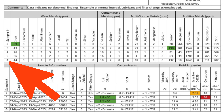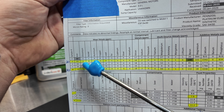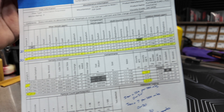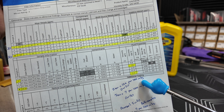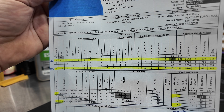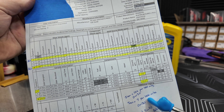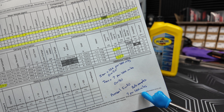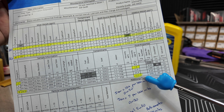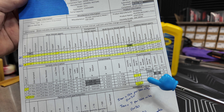This is number 6. If you're wondering what 4 and 5 are, that's the Pennzoil 5W30, and I had excellent results there. Once I went from the 20-weight to the 30-weight, you can see my iron actually dropped to 26, 36. We're checking iron per 1,000 miles. With the 0W20 engine oil I got a reading of 10.9 ppm of iron per 1,000 miles — that's okay, a decent number. But when I went to the Pennzoil 5W30, it dropped to 7 ppm per 1,000 miles, which is a good sign because that means less wear is going on inside the engine. The viscosity is also increased, which in my opinion gives better lubrication and protection on the engine.